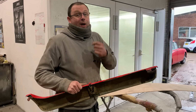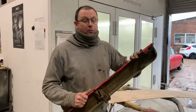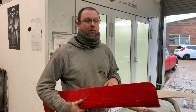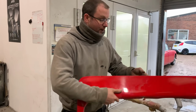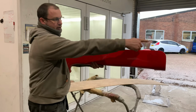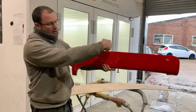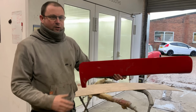All right, winter's well on its way. It's bloody freezing here today. Still waiting on some panels, so we're going to get ahead now. Start fabricating up some bits for the rear panel on the wheel arches. We're going to start that by templating. This is the wheel spat that goes in, and I've got the corrosion all the way along here. So we're going to start by just making a template around the outside of this, which will give us a former or a guide as to where we need to be.